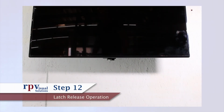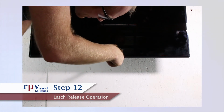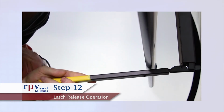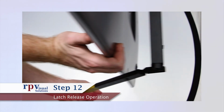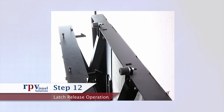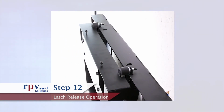Step 12. Latch Release Operation. To unlatch the display, insert the latch handle into the latch release lever at the bottom of the latch release arm. Turn the lever to the left to release the retaining hooks. The display should now be free to extend out from the wall. To return the display to closed position, simply push the display back until the retaining hooks latch into place.